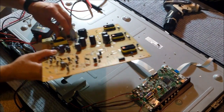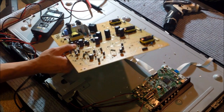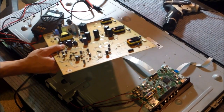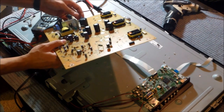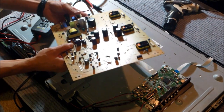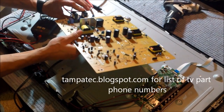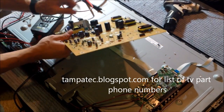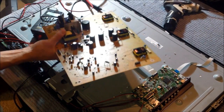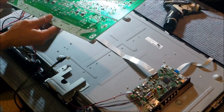That transistor I have to cross-reference. I could get it on Amazon, eBay, ShopJimmy, River Valley Electronics, or a bunch of other places online. Go to tampatech.blogspot.com — there's a link on my channel — and there's a huge list of all these different places that sell TV boards and parts. But it looks like this transistor is the culprit — it definitely reads shorted.